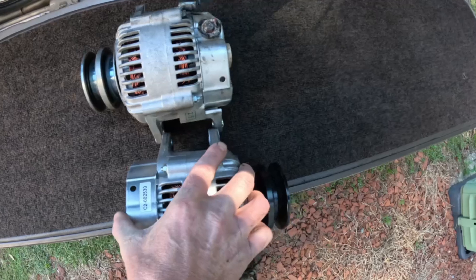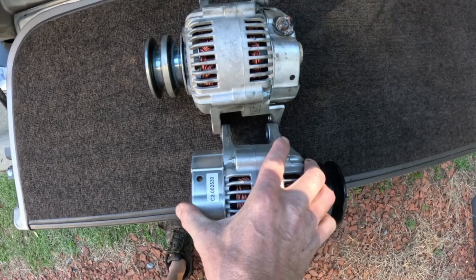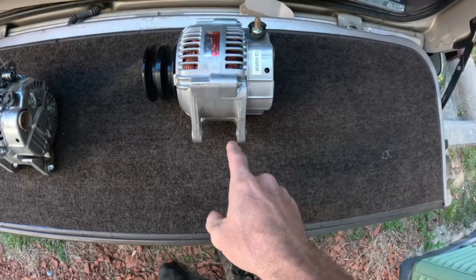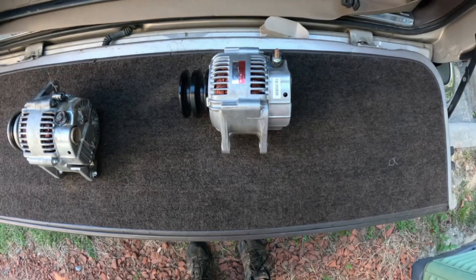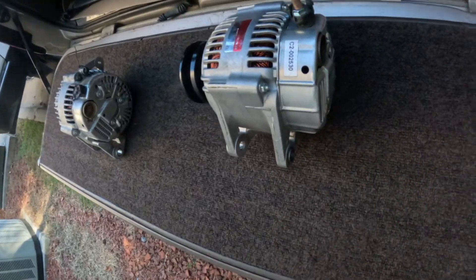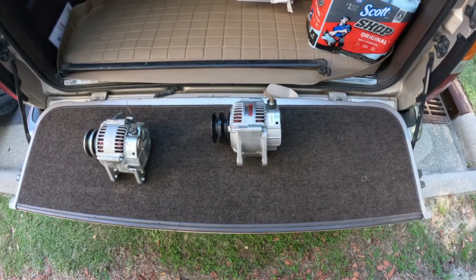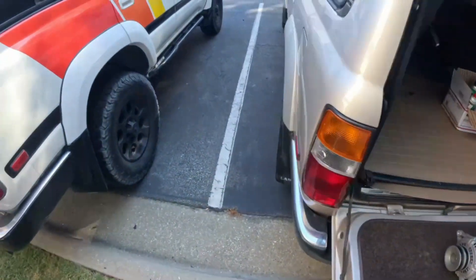Let me set them up next to each other. As you can see, there's a little bit of a difference. So that's why we're going to have to make a modification to these dog ears on the 90 amp alternator, because of the difference in how those sit. I was thinking about doing this and I just didn't want to go cutting on these dog ears aimlessly — I want to think through the easiest way so I can show you and get the most accurate cut without having to guess. So let's go back over to the front.